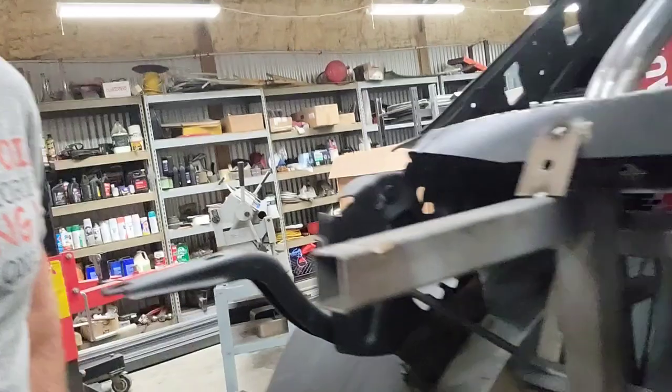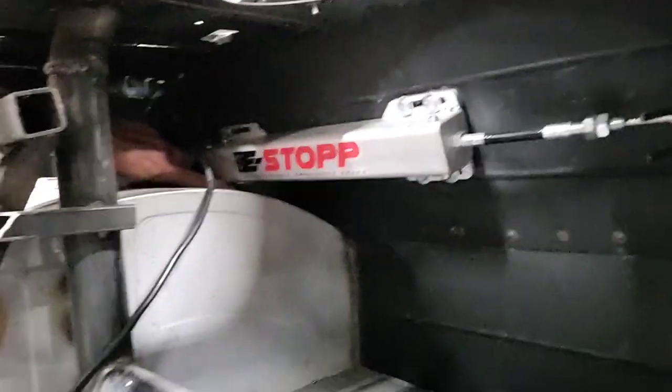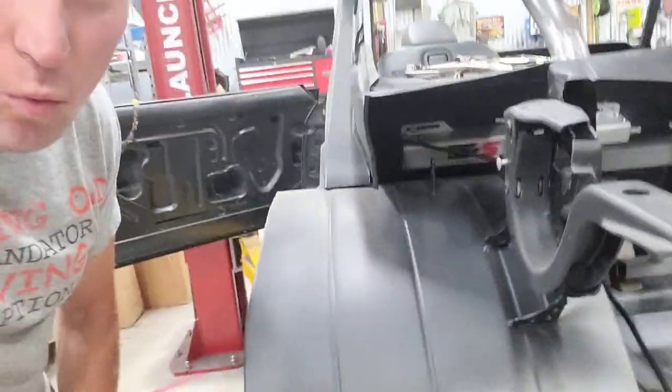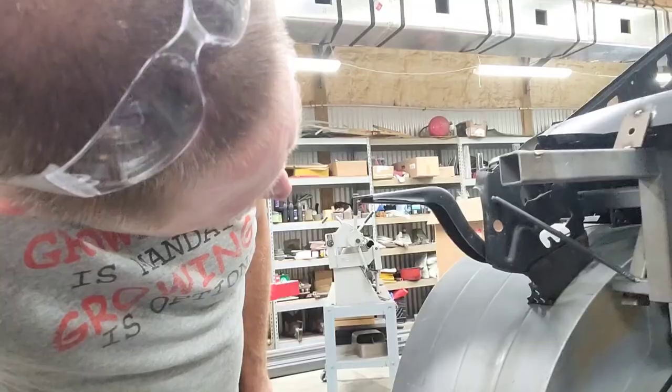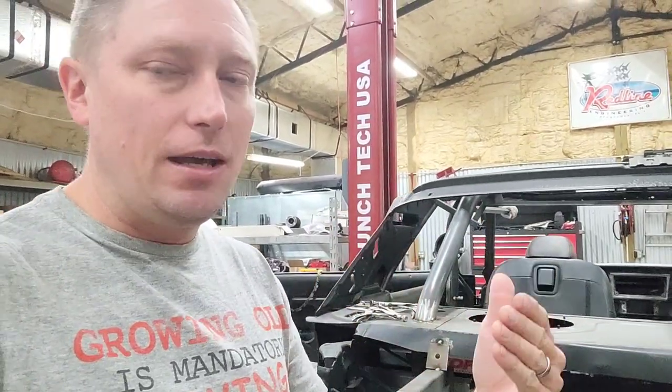Full disclosure — let me show you where I screwed up. You see those bolts that secure the e-stop to the package tray? There's actually a hole on the bottom side where I installed one of the mounting holes for the e-stop, but there's no room to get a bolt way up inside there. There's no way I can get that last bolt in. That's why I chose to do extra mounts on the front side of the e-stop — so I've got five bolts holding it in place to compensate for the missing one on the backside. If you're mocking something up like this, just because you can hold it in place doesn't mean you can access it later, so try to think ahead.